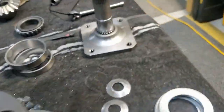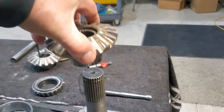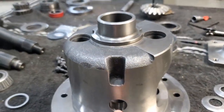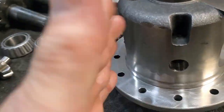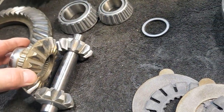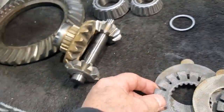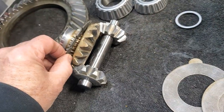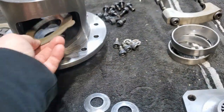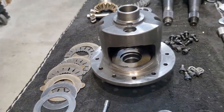This is your side gear — it comes on your axle. It needs to get loaded from the carrier pin. All the drive is on this pin here. So when this rotates, it wants to push and slide out and push against the clutches. You have these that are locked into here on your side gear. The other ones are in your carrier, locked in there and driven there. When they get squished together, that's how your posi works.